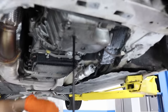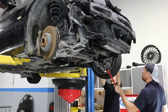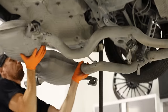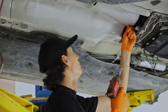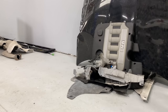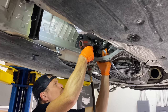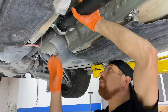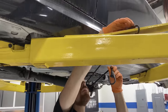All the fluids are getting dropped out, all the panels from underneath. We're going to pull the wheels off and take the calipers off. Joey is very brave — while I smack the wheel, he's holding it hoping not to get hit in the face. We're going to drop the exhaust so we can get access to the drive shaft. Everything under the car is chalky and dirty — like a white dust or white mud — because the previous customer lived way out in the country on a dirt road. Now it's time to remove the drive shaft. I remove all six bolts and pull the rubber disc out completely, then remove the center joint. This thing will definitely hit you in the face, so I use a bungee cord strap and pull it off to the side, strapping it to the lift arm.